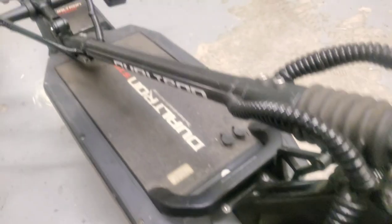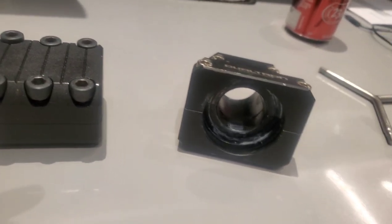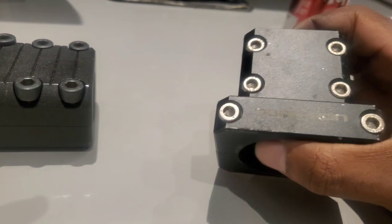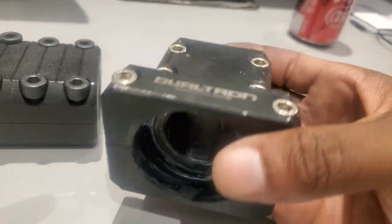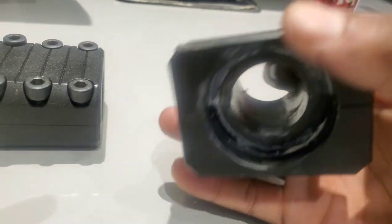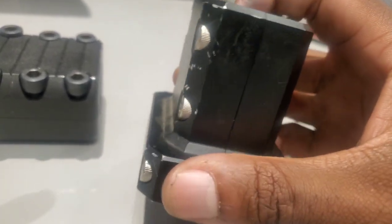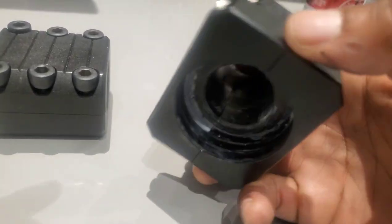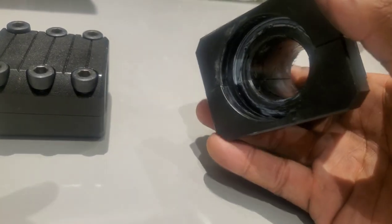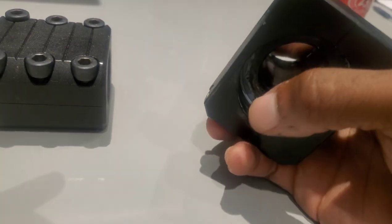If you like this clamp, this one right here, you can use it, but just know it could potentially loosen it. When I'm at it, I figured I'd show you guys a full comparison. This is the one I just showed you — just took it off and put it back together. This outer ring right here will attach onto the castle nut, so now you guys can get a better visual. When it's sitting on the castle nut and you move your stem back and forth going over bumps, all this vibration could loosen it more over time. All bolts could loosen, even with Loctite. But obviously this could loosen it more because it's hugging the castle nut.